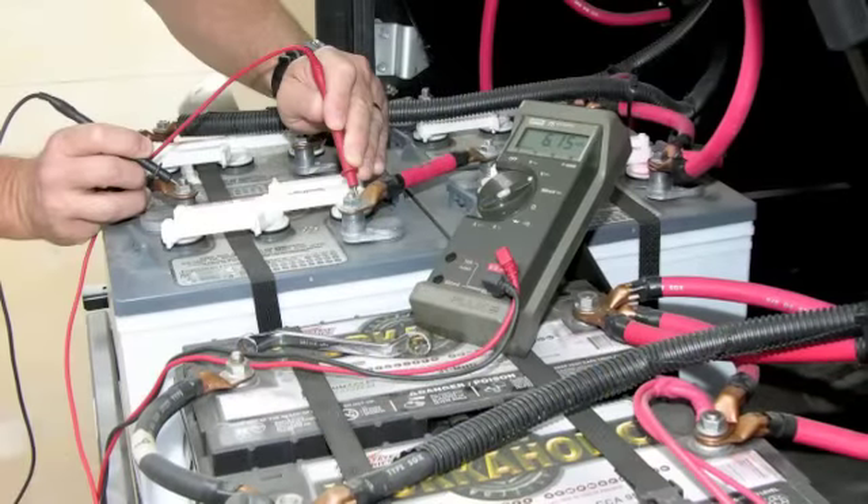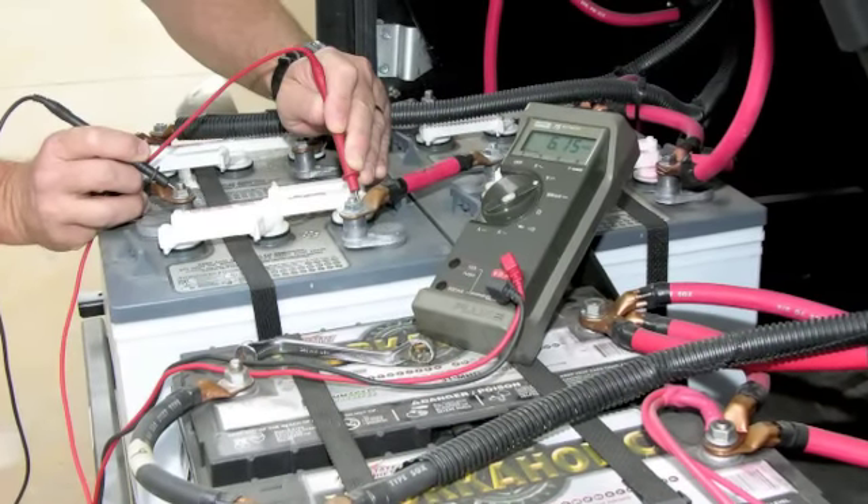Without a charge controller, if you're not in tune with the 12 volt DC system or don't have an understanding of troubleshooting it — which most RVers do not — I recommend taking it to a professional to have it troubleshot and analyzed. A quick way to determine if it's working, if you have a volt ohm meter, is to measure the voltage at the battery during the evening when there's no sun, and then again during the heat of the day when the solar panels are fully exposed to the sun. Make sure everything is turned off inside the coach that uses 12 volt DC.